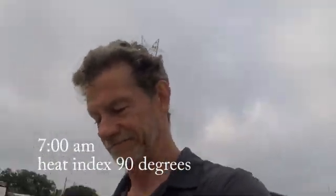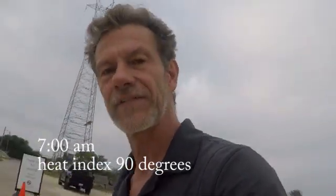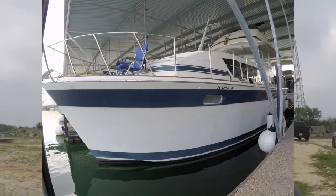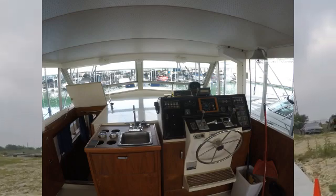So the other day, I took the whole family out on the boat along with some friends, and this has probably been our third outing for the year, maybe fourth. I fired up the starboard engine and got going pretty quickly. Warmed up to about 1,000 RPMs, got the other one going, idled the starboard engine down a little bit. 700, 650, 500, it tried to die. I gave it a little more gas. Too late, it died. And ever since then, we haven't been able to restart it.